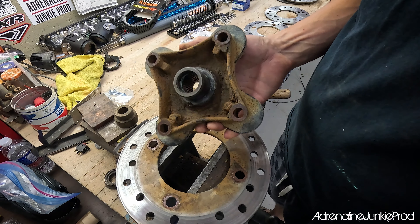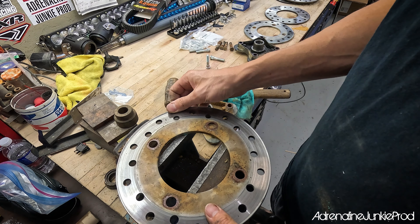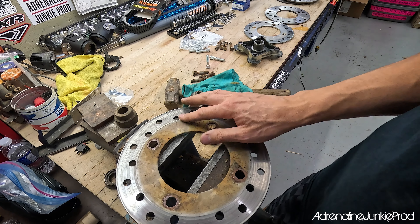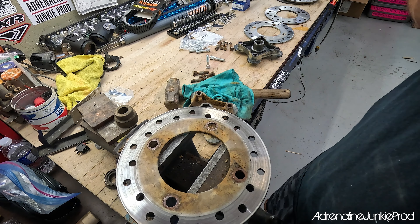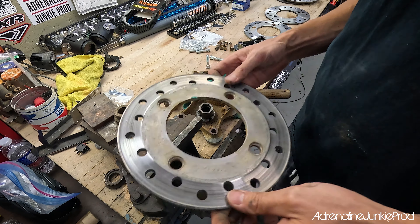These assemblies — as long as you don't see any excessive wear on the surfaces, waviness, or pitting, you're fine. You can reuse these. They've got a long life cycle. Once the last stud is out, the rotor will separate. That lifts right off. As you can see, there's years of crud in there. There's not that much depth taken off — I bet you could remachine these and reuse them. Since I don't have access to that right now, we're just going to replace them.